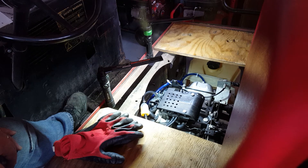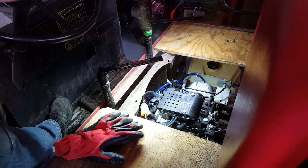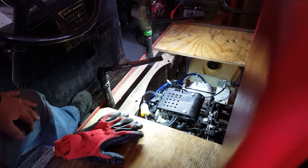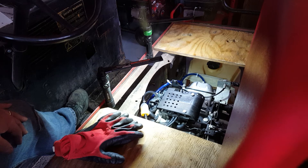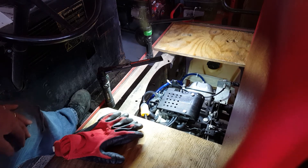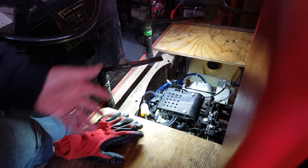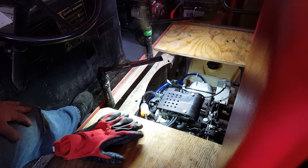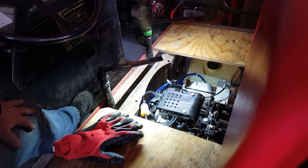It's probably the carb. And I'm not touching the pedal — there we go. It needs to come up just a tad when it's cold, then it'll be too much when it's warm obviously. I put fast-fire plugs in it — the equivalent of Champion 12CNY. I'll have to check on those numbers.